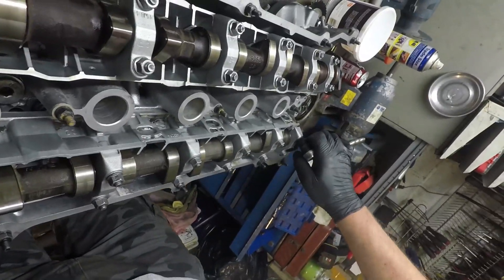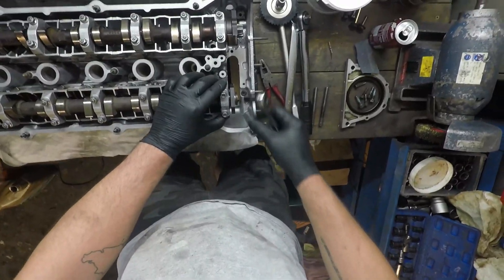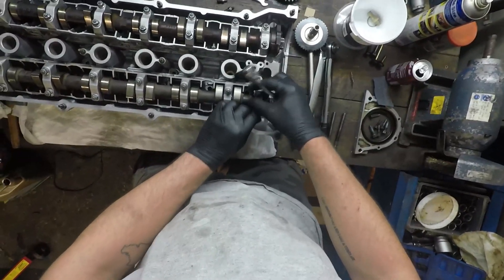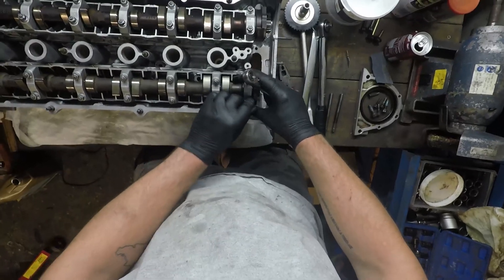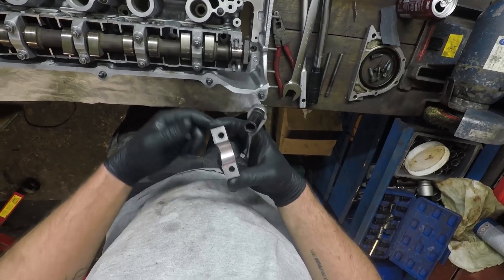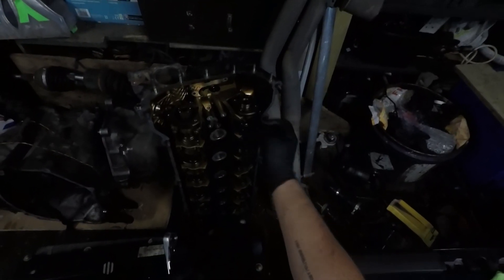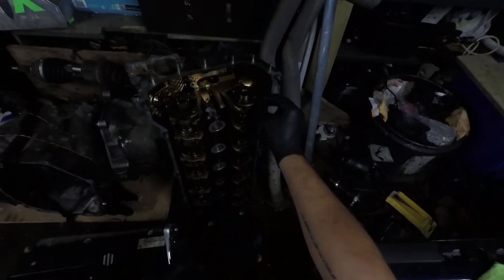Now this is the cap I had a problem with. This cam cap was slightly different to the tray it came from — this tray is from the M54, and it had a locating dowel underneath cam cap one. The cap from my 323 doesn't have the space or the counterbore for that dowel. So I rob one from the M52 head, which is the same as the M54 cap. It's not quite as clean but I give it a quick wipe, and we'll use this one because it actually fits the cam lifter tray better — it has the counterbore cut so it sits down over the dowel nice and flush with the head.